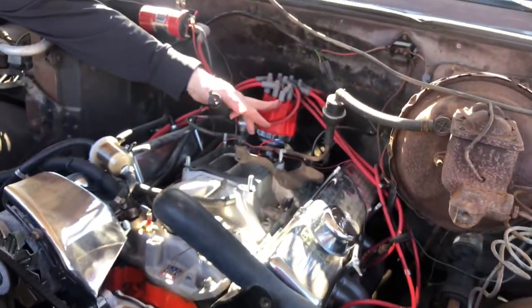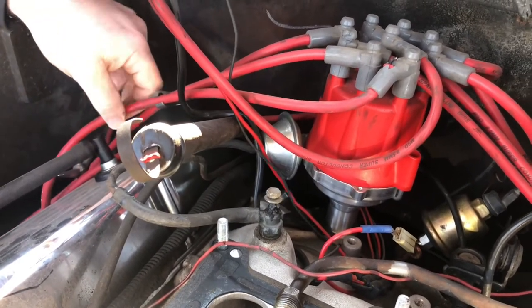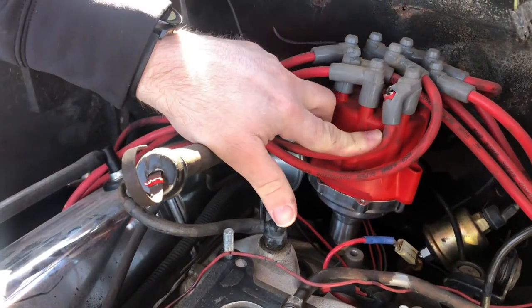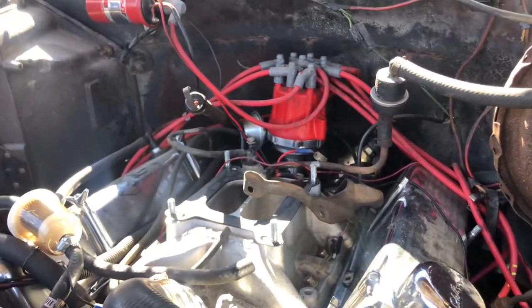That's a problem. You got a dead cylinder. Whichever one it's connected to is dead. Number four, the back cylinder back here. That spark plug wire is completely trashed. I think that happened when I took it to the last transmission shop. I noticed that.